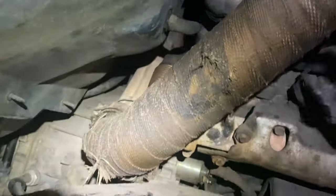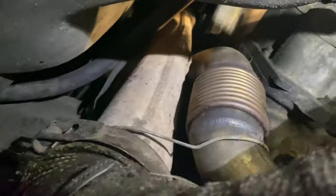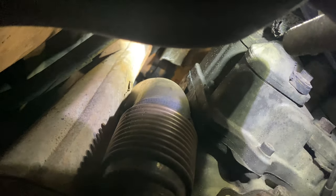I happened to grab the stack pipe and it's moving - that's not supposed to be doing that. If I look up in there... my whole down pipe is moving a lot and I can see oil. It's really hard to show you but see all the oil right there - that's on the back side of the turbo pedestal. It's got tons of oil on it and it's looser than hell. I wonder if it is just a blown up turbo.